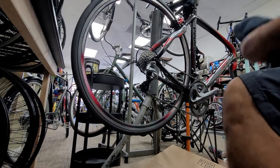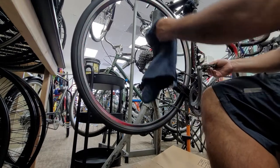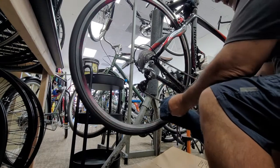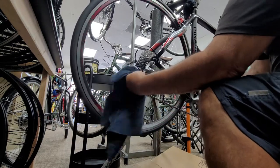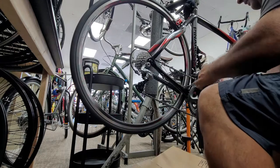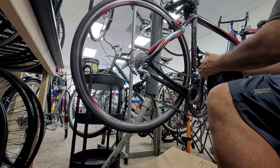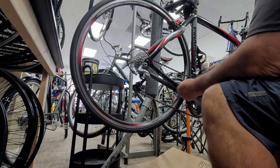After we add the oil, now we're going to clean it up, every single piece. Even the chain, we're already shifting up and down. You don't need oil outside. You just need oil in the pins and the little rollers. The rollers, the wheels, all these can be cleaned. Even the pedals, the spindles need to be clean, lubed, and ready.